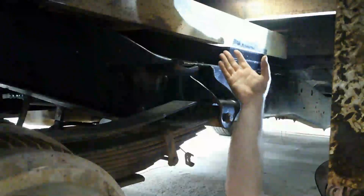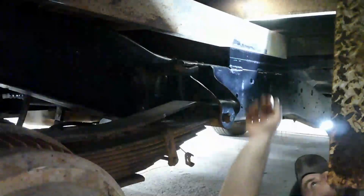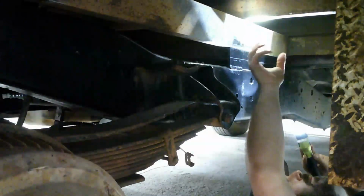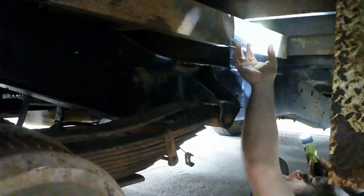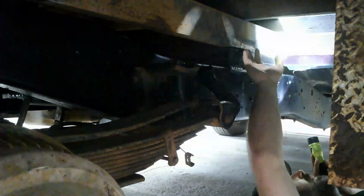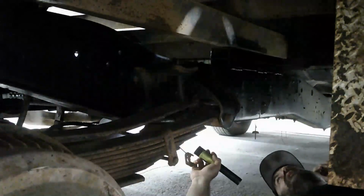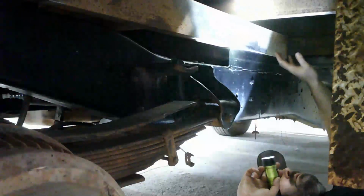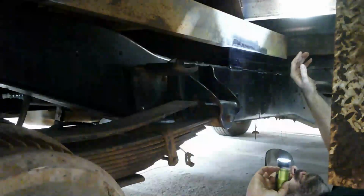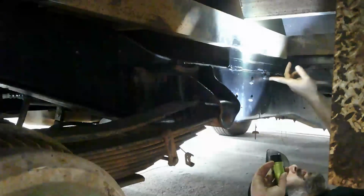So when this bed was made, I'm assuming these rails were supposed to be put together and be the same width. Same with this truck frame. Well, the width of the outside of these rails and the width of the outside of my frame are the same. But when I've got this bed squared up on the truck, I've got about a 1/4 of an inch gap on this side. And that side over there is hanging off about a 1/4 of an inch. So these rails either didn't get put on right originally, or stuff's moved over the years, but they're off a little bit, which is going to make putting the mounts on a little bit difficult, but it's not terribly bad. We'll get through it.